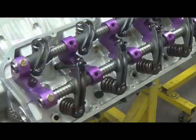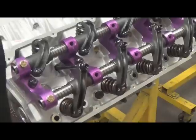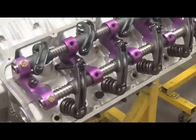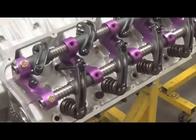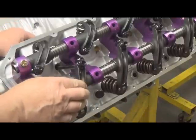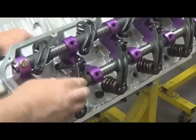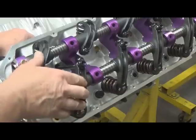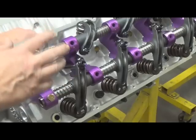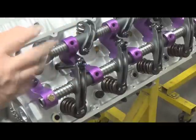Once you're done with the intake, go ahead and adjust the exhaust. Watch your intake rocker arm, rotate it over to full lift, and when it just starts to stop and change direction — starting to close — now you can adjust your exhaust rocker arm. That again assures you that you're on the base circle of the camshaft. Use that theory on every cylinder.